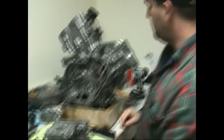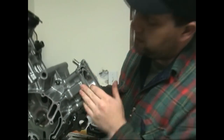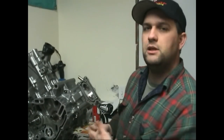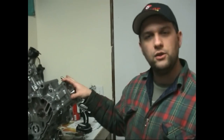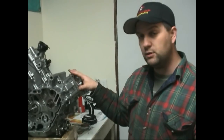This particular motor runs with base gaskets — the gasket between the cylinder and the case. In this particular case I need approximately three base gaskets. It's okay to stack these three base gaskets. I'm using OEM Suzuki base gaskets and they should be able to handle the stacking of three. I don't want to go any higher than three, and there was no reason to order a single base gasket of the equivalent thickness.